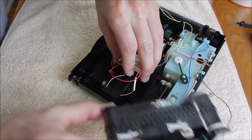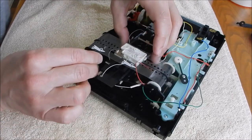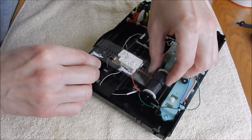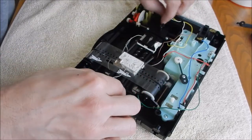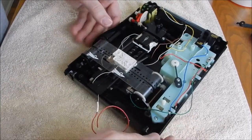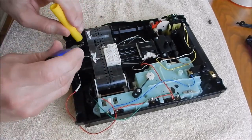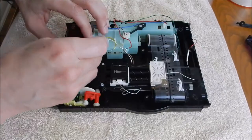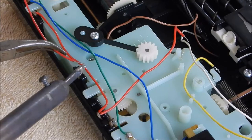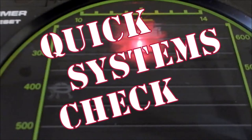Reassembly should go pretty quick. Pick up the film mount, bring the firing assembly through the center of it, pulling the white wire through the center of the film mount — mine's red but yours will most certainly be white. Make sure the film mount is down on the screw mount securely. Do not test the machine without screwing down the film mount — it will stick and could damage something. Put in the four Phillips screws, put the spring back in, and re-solder the white wire back to the gearbox.